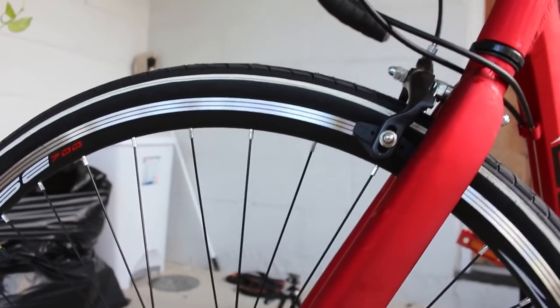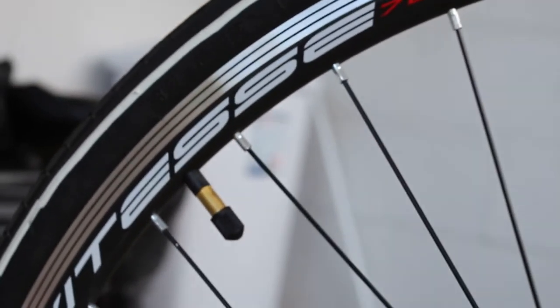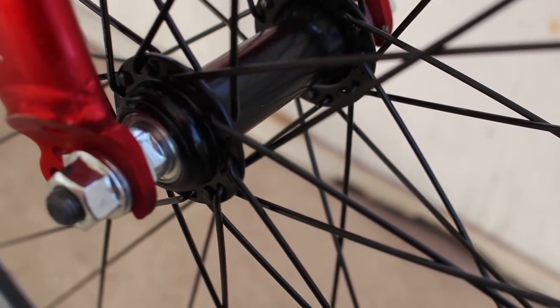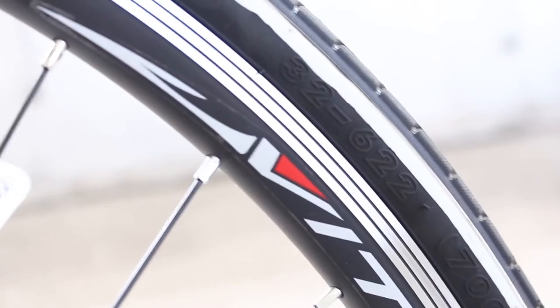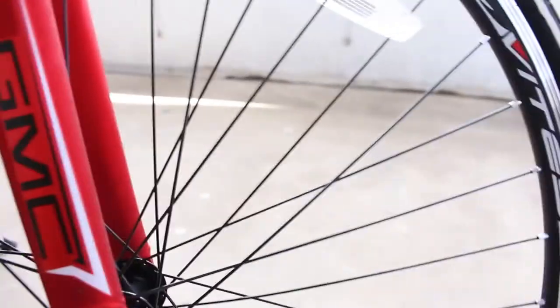Let's take a look at the wheels. They are aluminum wheels with stickers, attached to no-brand hubs which are loose ball bearing, not sealed. By the way, they are not the truest wheel — yeah, that's pretty bad. They're definitely not a slick tire; they do have some gripping profile, which is absolutely fine for this application. These are 32 millimeters, which I think is pretty nice for this type of bike.